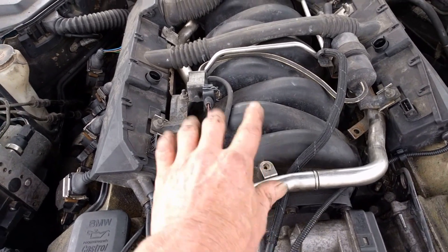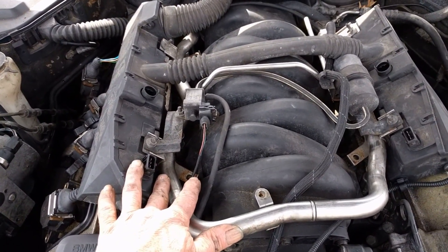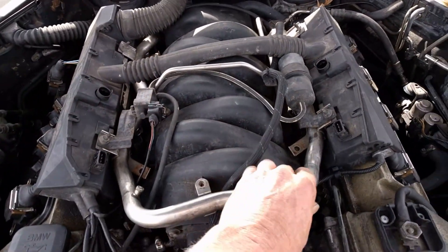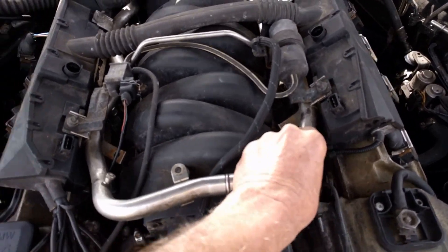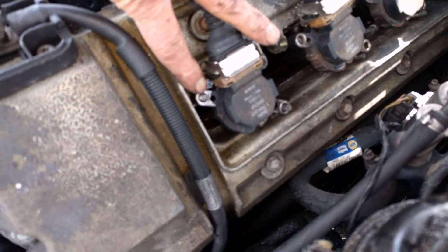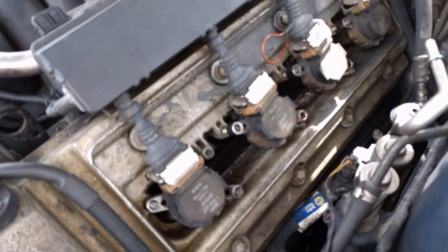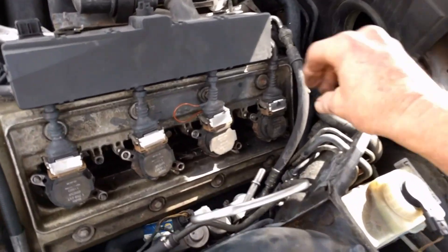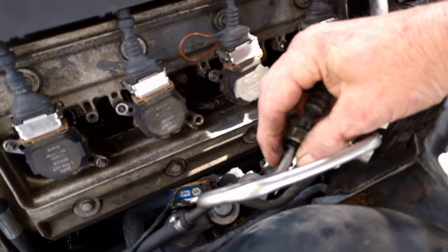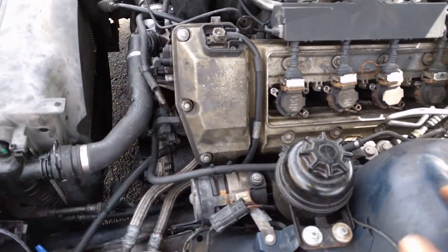You've got five bolts — of course you have your cap pieces on here that hold your cover, you take that off and take your five bolts out and the fuel rail comes loose. You have to take out your coil packs — two nuts on each coil pack, number 10 nuts. Take all those out on one side, then the other side. Your fuel line has these nice little push pins — push the pin in and wiggle it and it'll come off. Take the fuel line loose.